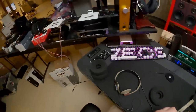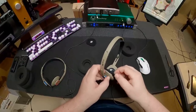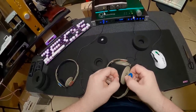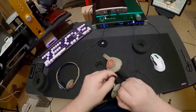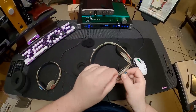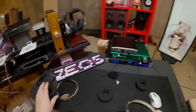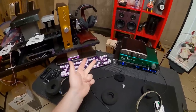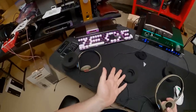Oh God. I did the sound demo, by the way, with that setup yesterday. So it's just no treble hole. The sound demo to record this pair of headphones was the most equalized and corrected sound demo I've ever done. More than Abyss. When I got the Abyss headphones, I was like, I need to deal with the planar, the planars have magnets. For some reason, this, I don't have a pair anymore, this with the pads on it was nearly impossible to record. I was dropping the 20, 45, 50 hertz equalization bands 12 decibels down, or it was just bass. I don't understand it.